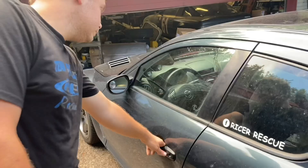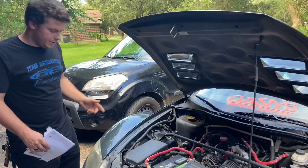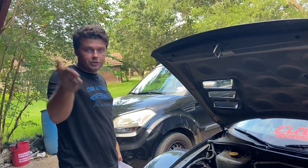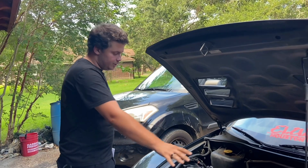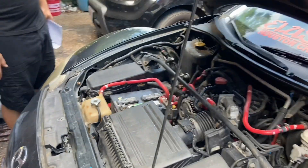We've covered the basic questions, so let's run you through an actual engine bay to point out where the different things are — especially if you're new and just bought your RX-8. On the RX-8, the radiator is actually up underneath in a kind of V-mount location, slanted towards the ground. The fans are bolted right to the back of it. You can't really see the fans in the engine bay because of the air box, battery, and coolant reservoir.